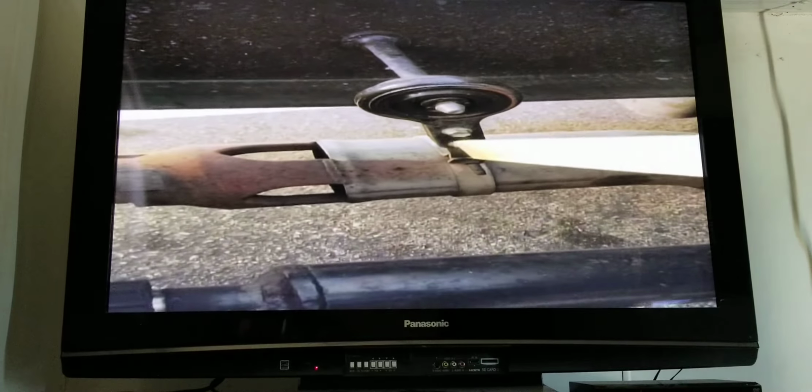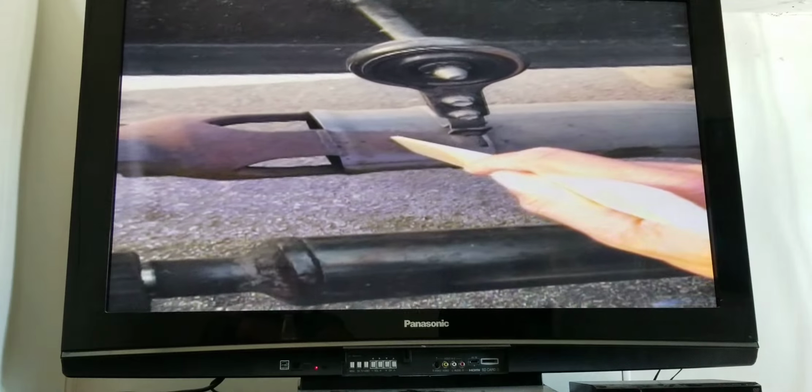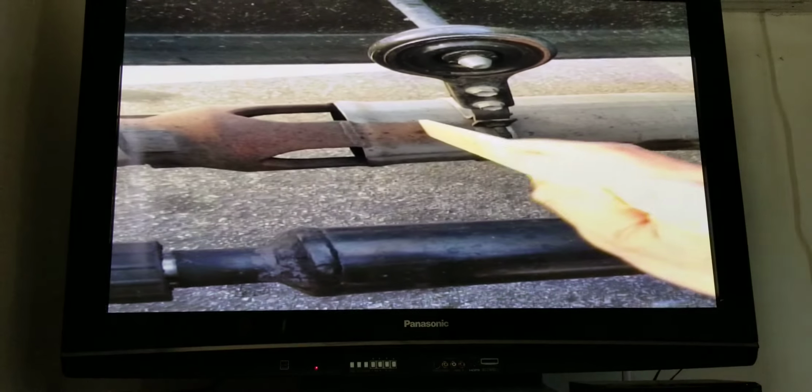I have my exhaust system. It is properly mounted. There's no loose or missing bolts. There's no bends, cracks, or any illegal welds. My straps are secure, and there's no carbon soot or any lines dragging around or near it.